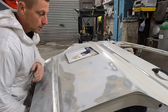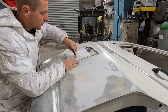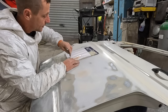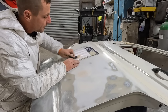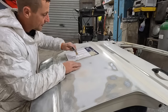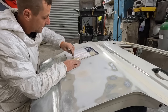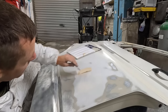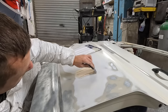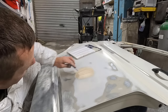If you're repairing a dent your first skim of filler will look a bit mediocre - my filler work's not the best but I can get it where it needs to be. Your first bit won't look that pretty but your second bit will look a lot nicer because it's flatter. So again if you can get your metalwork flat, your filler goes in nicer, and the better it looks the easier it is to rub out. Hopefully this one will look a bit better and I'm going to go a bit bigger with this one because even though they were small dents, it's surprising how far they went.